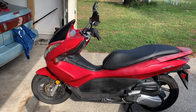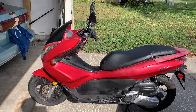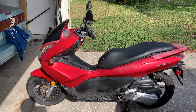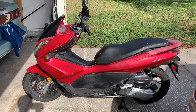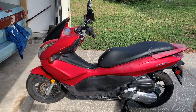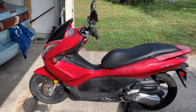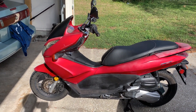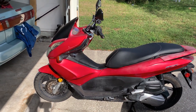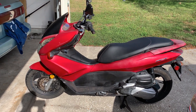How often should you do this? I bought this bike with 27,500 miles on it — that was the first time the valve cover had ever been off. At 27,000 miles, the valves were almost exactly in spec: intake was exactly in spec, exhaust was a little on the tight side but still basically okay. They say check valves every 4,000 miles — I think that's overkill. I'd check them at 1,000 miles on a new PCX, then every 10,000 after that. I'm going back in now because my valve cover is leaking a little oil, so I'll reseal it with RTV silicone.